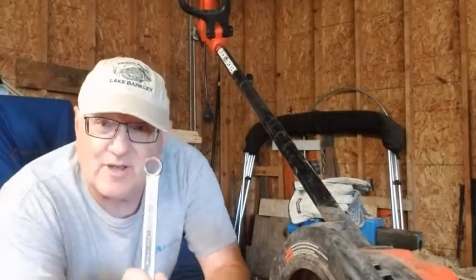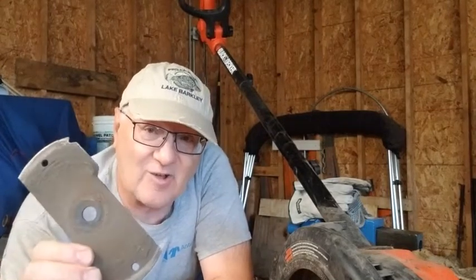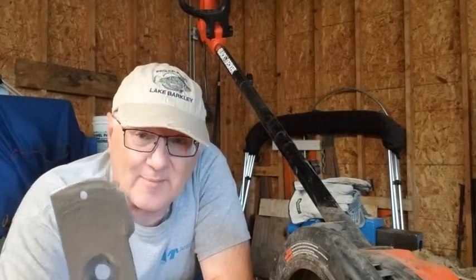So there you go. From my two good hands, easy tip. You might need something like this. You might not. You probably grab it with pliers. It was actually pretty easy. You're going to need a 14mm wrench or an adjustable. That's probably going to do you just fine because you're not going to change this often, so you're not going to wreck that nut too bad. You end up with 2 extra spacer washers. I got the old blade, don't know what to do with that. But it's amazing that we wore off a 1/2 inch of steel on this, or 1 inch in diameter, over a 10-year period.